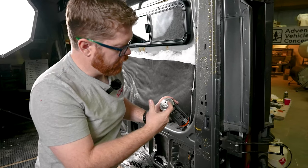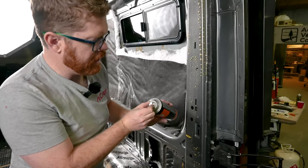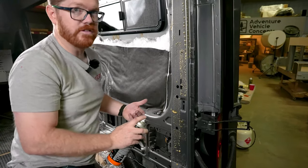One of the cool features about this 3M74 can is the applicator tip. Right now the fan spray is vertical, and if I twist this little black tip, we can get a horizontal fan which is going to make spraying our columns much easier. You'll also notice an L, M, and H on here — that's for the amount of pressure or the field of spray that comes out of the can. So the H gives a really wide spray, and low gives a more accurate spray.